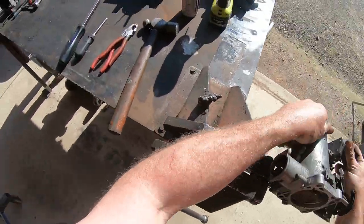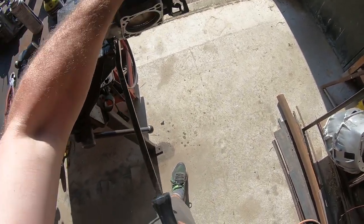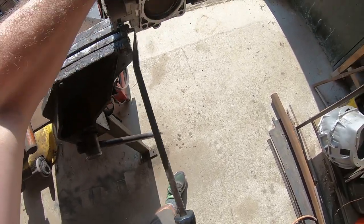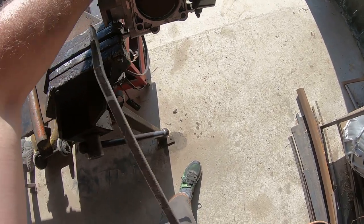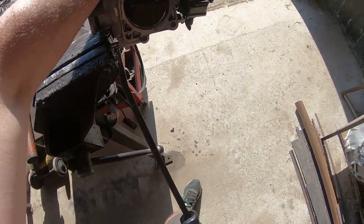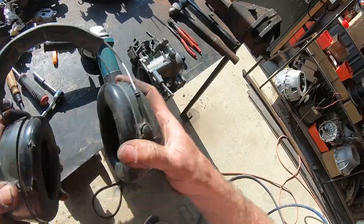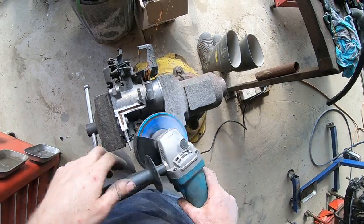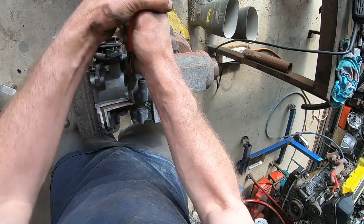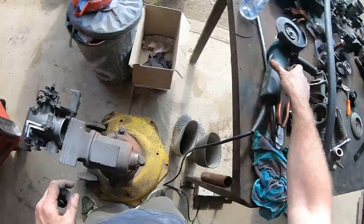The next bit - I'm going to remove the water pipes. Often I can put them in a vice with a lever bar, give them a wiggle and they pop out. It wasn't budging on this one so I went to plan B anyway. Here comes the grinder with the sanding disc. My plan is to remove the water galleries off the bottom of the throttle body completely - that'll enable that little water fitting to come right out because you've taken away the base it actually sits into. That goes into the rubbish.